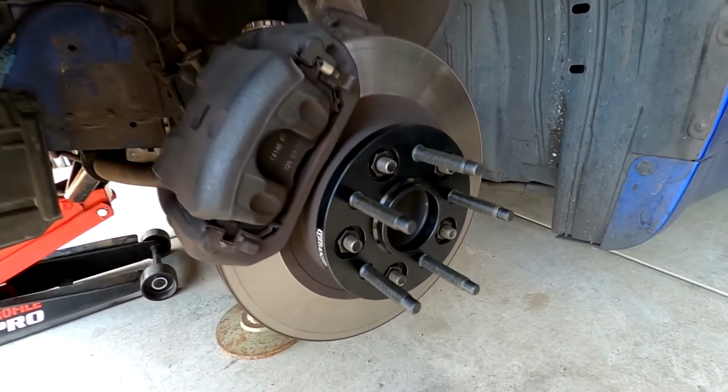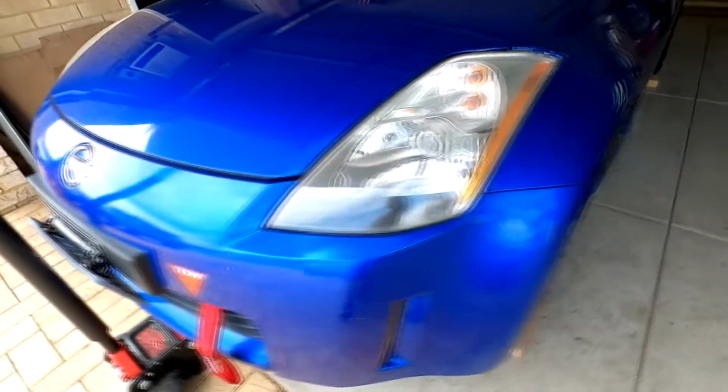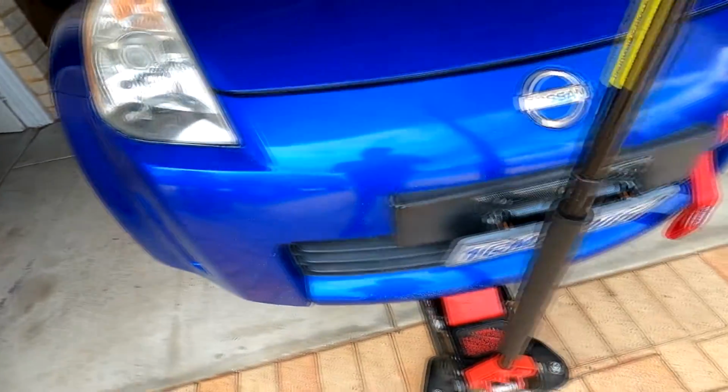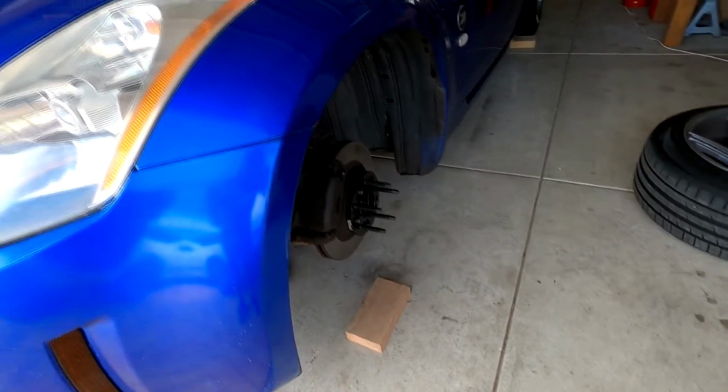We're at just the standard 10mm, and obviously that's a tyre at stock, so there's a little bit of wheel poke. These are the D-Speed DS03s, 17s by 9.5, so when it sits on the ground it actually just tucks in on the guard. So pretty interested to see how the 10mm is going to look. We'll bolt one up and show you guys what it looks like.